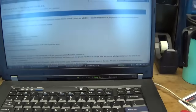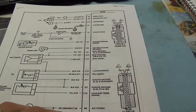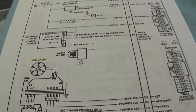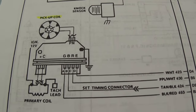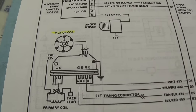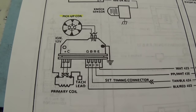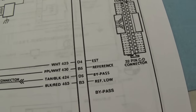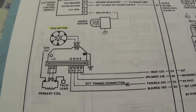I'm doing a little homework on AllData here. Got the wiring diagram printed out for the ECM. The system is pretty basic — it only has one input to the computer, and that comes off the distributor. It's a pickup coil, and that signal feeds into the ignition module. There are four wires connecting the ignition module to the computer, and the ignition coil is controlled by the module.